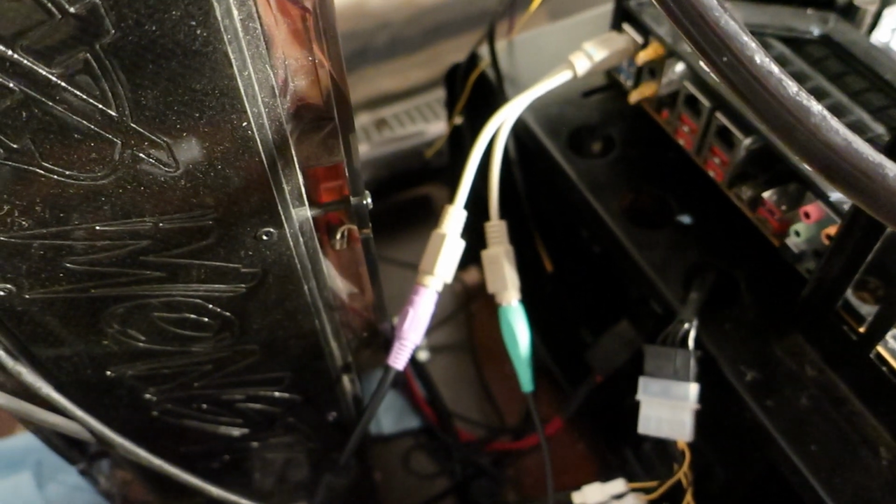Even if you don't want to use PS2 for either keyboard or mouse 24/7, you should have some very old and simple PS2 keyboard lying around that you can use in situations like this. You don't have to use it in your daily system. You can just have it as a backup in case you need it in some weird situation like this. A PS2 mouse is really bad for daily use, I know that, but in this demo I will just use it for the actual installation process.